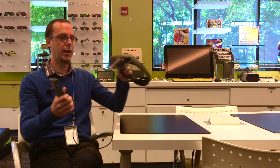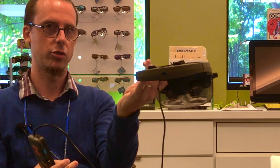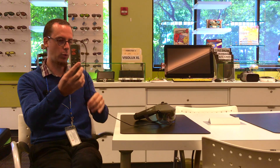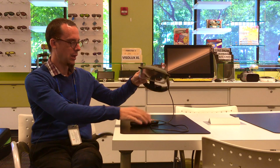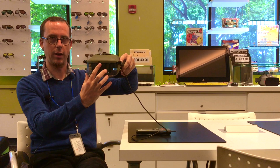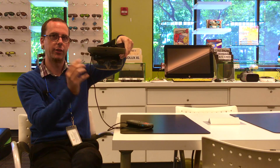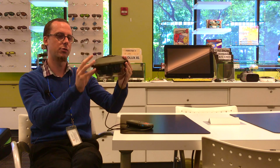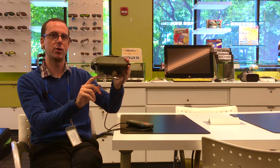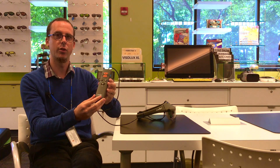This is what the ACE Sight looks like. It comprises of the headset, which we have here — I'll show you the back of that as well — and then we also have the controller, which is here. There is a wire which goes from the controller to the headset. Just like other wearable devices, this headset has a camera, which is found in the bridge in the front. On the inside, we have two video screens. When we're wearing the device, we are looking into the video screens. Wherever our head is pointed, the camera is also pointed, and we will then see that image on the video screens. Using the controller, we are able to manipulate the image so that we can see things better.